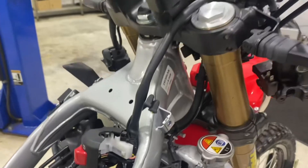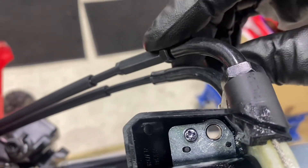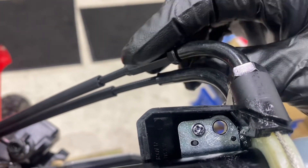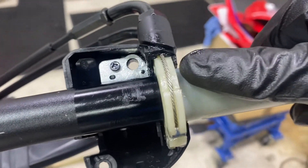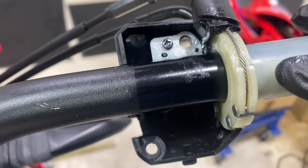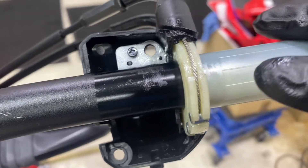It's quite a tight fit. The adjustment up on the top has to be backed right off, so you don't have to worry about the bottom - you've got heaps of adjustment here and a bigger cam, so running out of adjustment isn't a problem. It turns out it's exactly the right tension on a brand new cable when you do this mod.